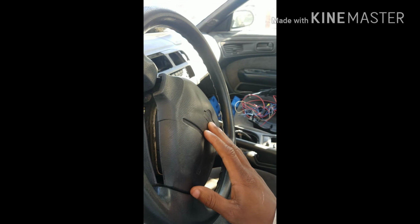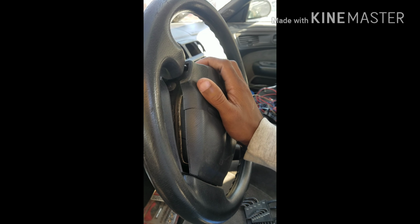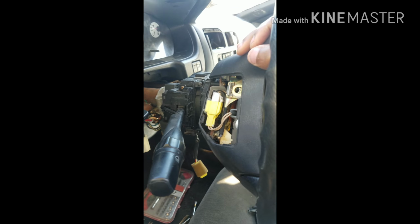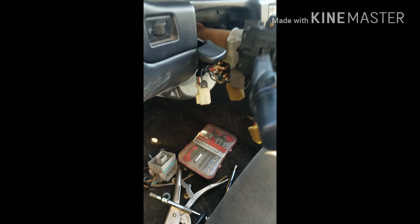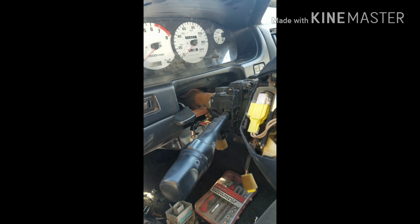By the way, I'm gonna put a message in the video, but you want to be sure to disconnect the battery before you do this. You do not want to be working on this and then have the airbag go off and your head explode or something like that. I mean, if you want to go to the hospital for free, then yeah, but just disconnect the battery, disconnect all of the plugs here, just to be safe.